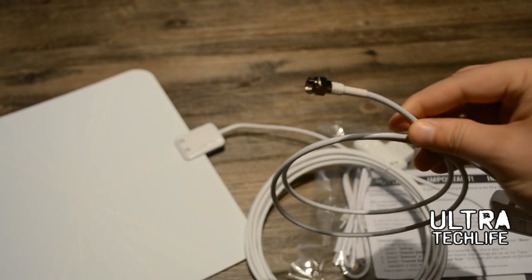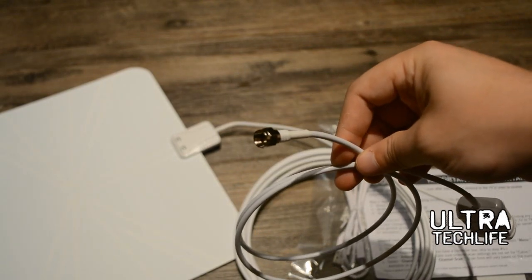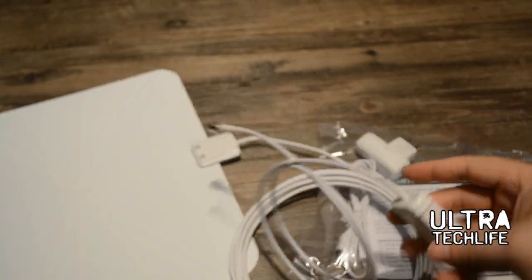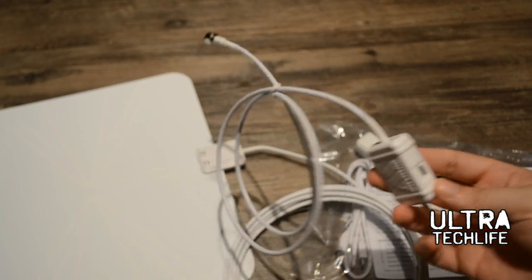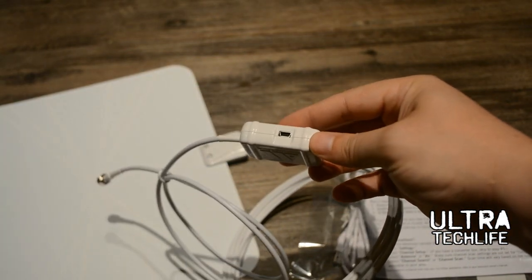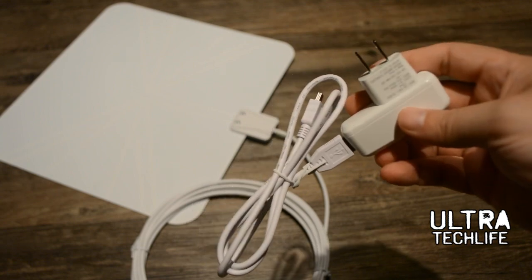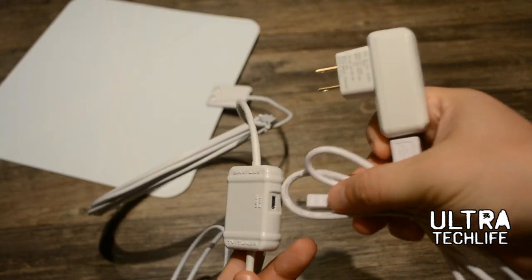We got to test this antenna. It has a very thin RG59 slimline coax cable — about 19 feet, which is enough to run the antenna anywhere as long as you're close to the TV. You don't want to break the line. You'll notice the amplifier — make sure that it's actually plugged in and powered up. It's powered by a 3-foot USB cable included with the amplified version, so you can go straight to the wall with the supplied adapter or plug into a smart TV's USB port.